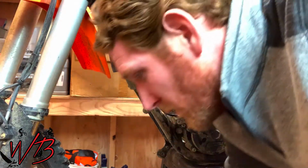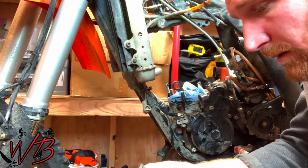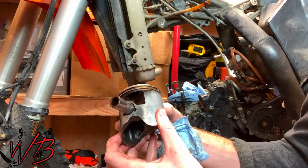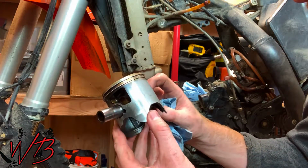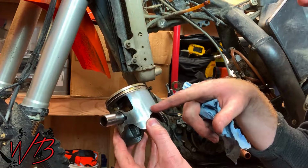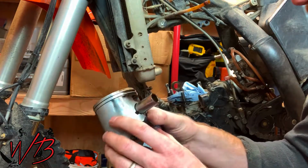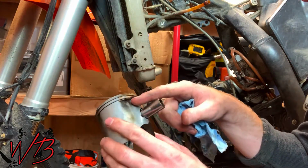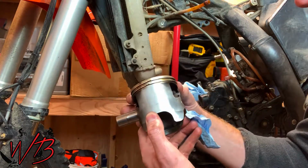Oh, okay. Well, that happened a little more abruptly than I was expecting, but no problem. Some things you can tell by looking at the piston. You can tell where it's wearing. So you can see that there's some wear marks here and here on both sides, and that's normal wear. It's nothing to be concerned about. You can also tell where there's blow-by, which is also here and where these dark spots are. And again, that's pretty normal.